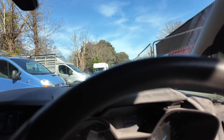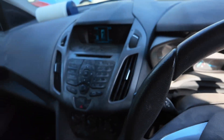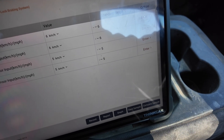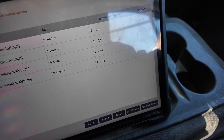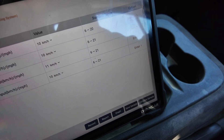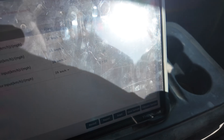We are outside in the car. We've got no ABS light and no traction light on anymore. We've also got the live data and we're just going to give it a quick run down the road. We've got all four sensors working. All the live data is good. We've taken it for a quick road test and it's got nothing back on the dash — she's all good, no codes, all cleared. Jobs are good. If you like what you saw, stick around, there's still more to come.